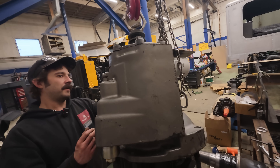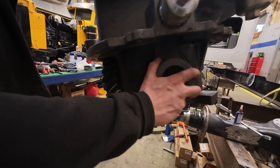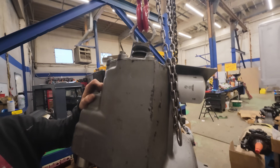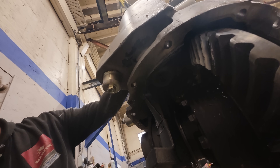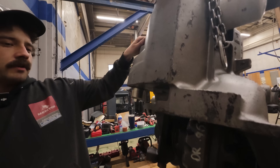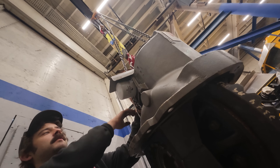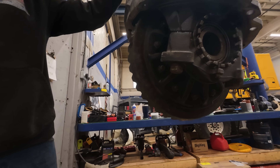We've got the very front axle of this tri-drive here and we're just about to drop the diff into the housing. Pretty standard setup — locking collar for the axle shafts, the ring gear, and up top we've got the power divider. Power flows through and comes out through this — there's supposed to be a through shaft here that connects to your drive shaft, which continues on to the rear diffs. It's the same for the middle and the front. The rear obviously doesn't have a power divider. This is your main pinion, and when you engage your power divider it locks in a collar, which then turns your drop gear, which then rotates — your ring gear puts torque to the wheels.